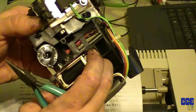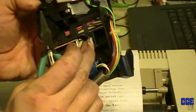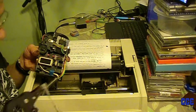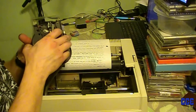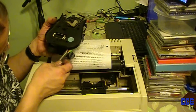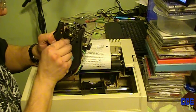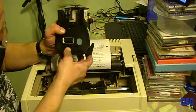That felt a lot more reliable than what it was. What I did was bend this piece of metal just a little bit to give it more support. Looks like it's working better. I'm gonna put it back together - take the daisy wheel and snap it back on. I see it kind of just rests in there - you have to watch that when you pull it off and put it back on. This coil thing has to rest in there too, so it's kind of a tricky thing to put back together. Make sure you put that in the right way, unlike me.